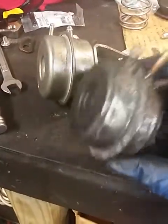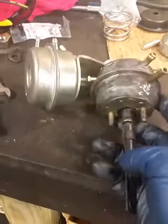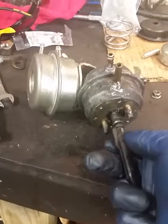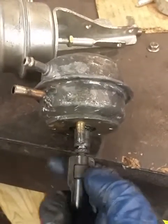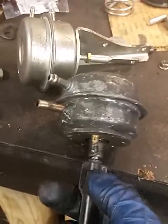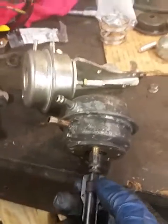I know it looks really bad, but it works. I think there's a five pound spring in there — I can adjust that with a boost controller. The other thing too, this is how you adjust the vanes being open or closed, kind of like the pre-setting. Because you don't want the thing putting five pounds of boost in at idle, which it theoretically can do, but we're not going to have that on this engine. It's not a race engine — yet.